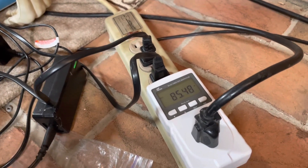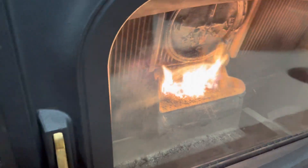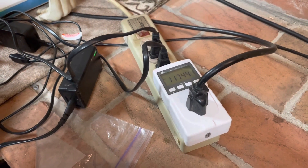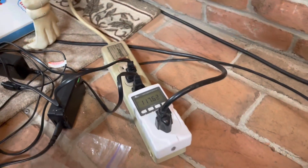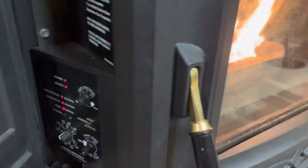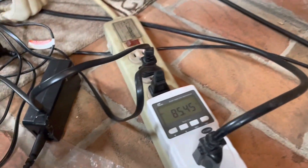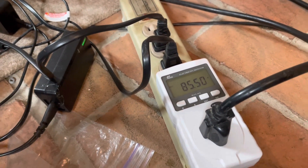It's still really efficient. Someone was saying they were getting 700 watts or some really high number — they might want to check their settings. It's much more efficient than that. So that's it really — the big surprise is that this is still a very efficient stove. At 85 watts, it's less than an old incandescent light bulb, and it produces a tremendous amount of heat.